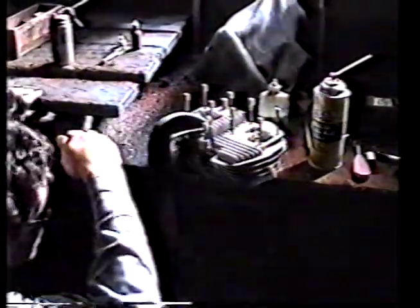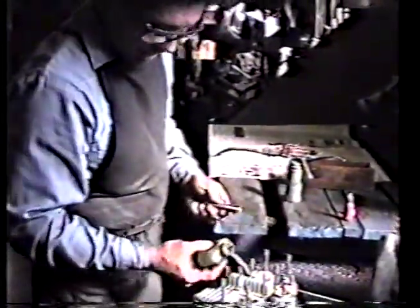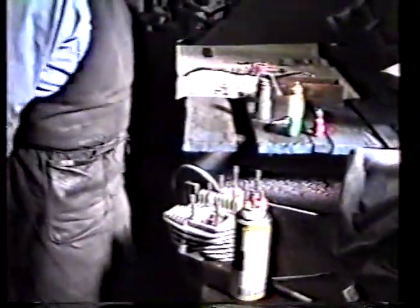What I'm doing now is cleaning the oil off these threads to make sure they're nice and clean so that the Loctite works. It looks in there really nice — no broken chunks of threads or anything. That's what the oil is good for: when we put it on the tap it's some special space-age stuff that keeps the cutter from ripping up the threads as we make them.